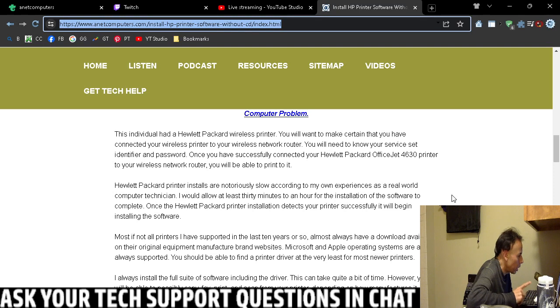But remember, I gave you a tip at the beginning of this video. I told you that when it comes to Hewlett Packard, do not connect your printer to your computer first. You wait until the software installation program prompts you and asks you to connect it. Now, the Ethernet cable is going to be similar. When it asks you how you're going to connect your printer, you just give it the proper choice. As long as that printer is on the same IP network, your computer and the printer will be able to talk to each other.